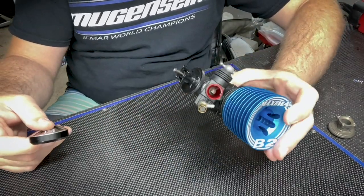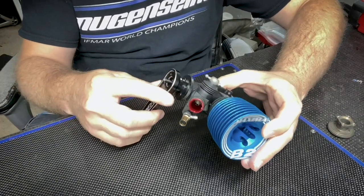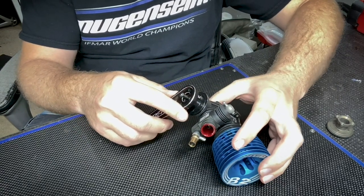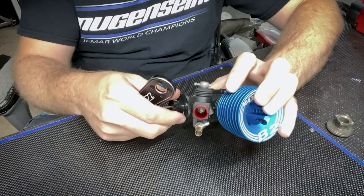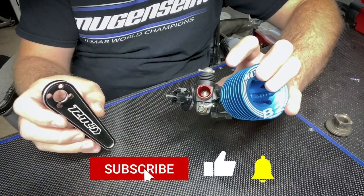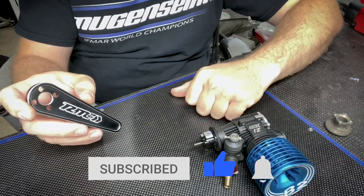That's as simple as this thing works. If you're changing just your clutch shoes, pull your clutch belt off, pop this on there, get all your screws loose, and use it to get your flywheel off too. Didn't have to use a pair of pliers, didn't make any marks or scratches, held it nice and tight. Worth every dime — it's going to make your life a lot easier. Thanks for watching, hope you guys enjoy!